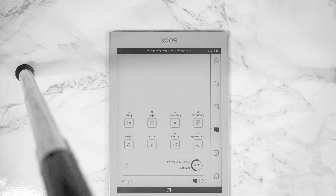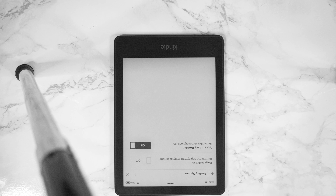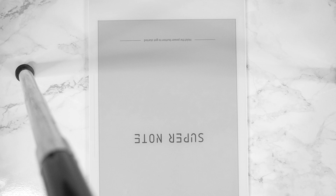What I always do with this test is, under the same exact lighting conditions, camera conditions, everything perfectly fixed, I take photographs of the same exact area in the same exact physical spot. I then desaturate those images and measure out the average pixel value to understand what the actual screen whiteness of each device is.